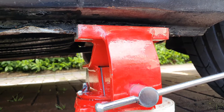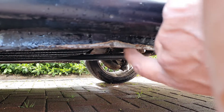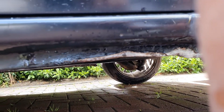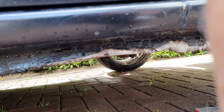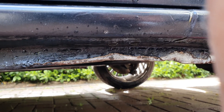Once you've straightened the sill out, you'll notice the pinch areas are exposed — basically sheet metal all pointing downwards. What I'm going to do is round it off by skiffing it with this hammer, tapping just the edge to turn the metal around at the bottom to give it a nice rounded edge. This keeps the seams away from the rust area; otherwise soil just gets straight into it. I'll do this across the entire length until it feels curved.